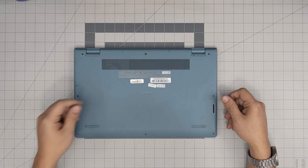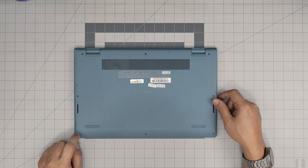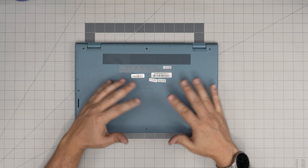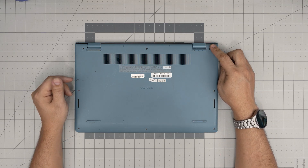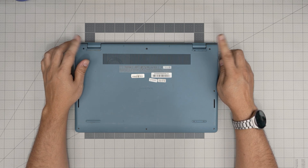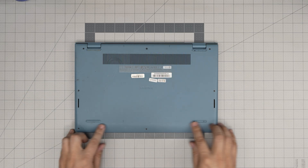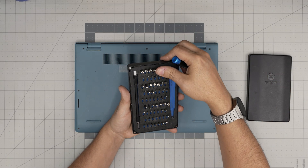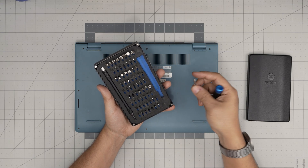The client mentioned they replaced one screw and applied epoxy and super glue on one side — but for you, all the screws are the same size, so don't worry about mix-matching them. We're not going to remove the two corner screws — one on the back left and one on the back right — we'll leave those for the end, and I'll explain why. First we remove the back mid screws, one on each side, and three in the front. I'll be using an iFixit screwdriver set — compatible storage and recommended tools will be linked in the description. We'll use a Phillips number one.